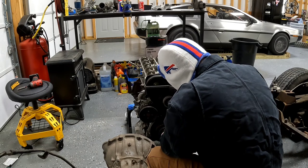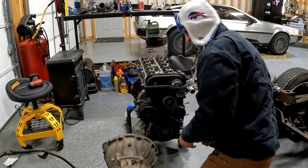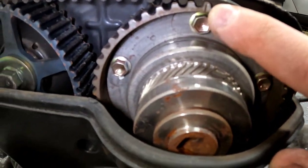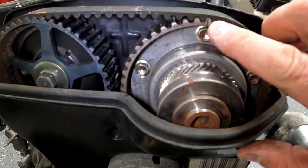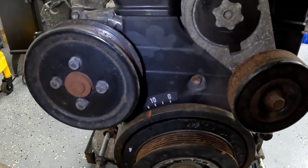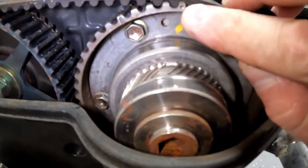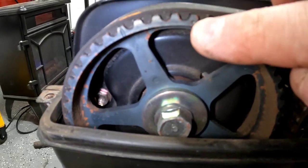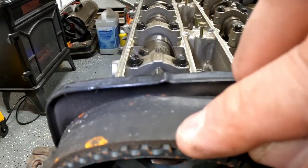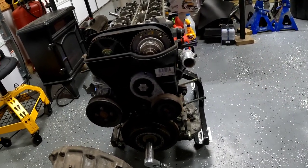I can already see the timing dart marks coming. So there's 60 before top dead center, and there's zero. When you're on top dead center on this motor, you'll see a straight hash mark. I'm at zero and I know I'm at the firing point on number one because I see that straight hash. Now what Toyota wants you to do before you start taking the head off is back it to the 60 degree mark. So I'm on 60 before top dead center, and now I have little round dots on each timing gear, and those dots should line up with these raised marks on the engine. Lines up. So this motor is timed now so that we can take it apart — we're not going to hurt the cams when we loosen them.